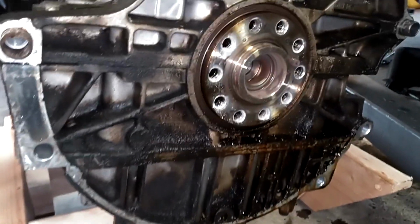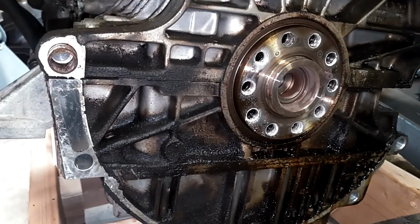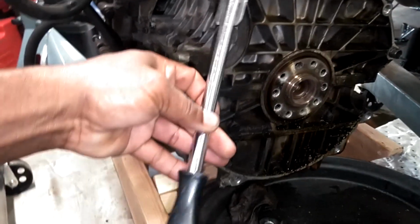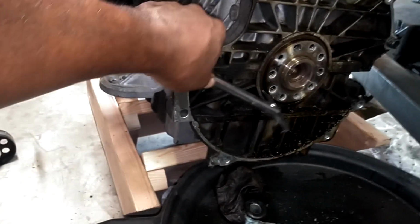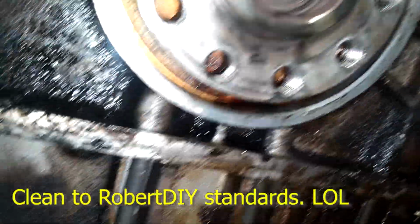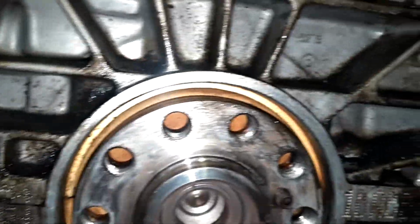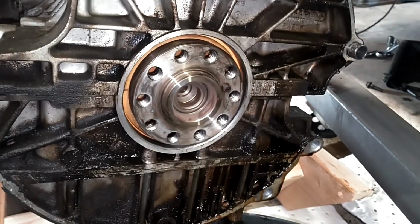Now we got this messy rear main seal. We're going to pull that off, clean that up, and grab the rear main seal tool and put a rear main seal in here, compliments of Santos. We have the seal puller tool. Get this in there, rip this out. I'll need 2 hands. Got this area all cleaned up, folks. We're going to wipe that out with a rag, get any gunk out of that thing. About to drop a new rear main seal in there.